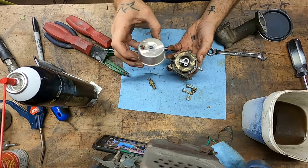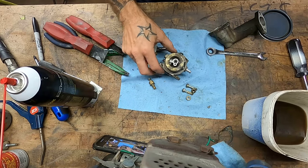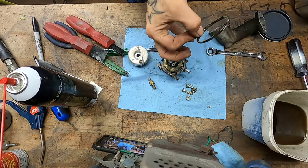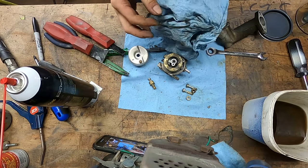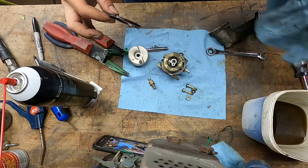Let's put this guy on. The low side goes over the pin. Oh, Christmas. Left and right, I'm forgetting stuff today. Let's go back over to our gasket that's been cooking in fluid film. Fluid film maybe, for all I know, is the worst you could use for this, but it always works for me. Leave a little bit on there. See, it's going to bring back that pliability some.